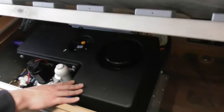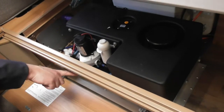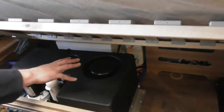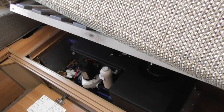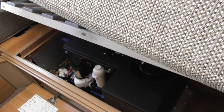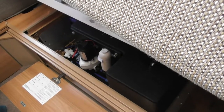Now we've got your lovely onboard tank — the instructions are nicely on the door. You've got two drain-off valves: one relates to your boiler and the other relates to your tank. Those are the only two drain-offs you need to know about. To winterise the van, all you need to do is just lift up your two yellow taps and make sure the white lever is pointing crossways, which is the bottom drain position. Then leave your taps open so everything drains down.